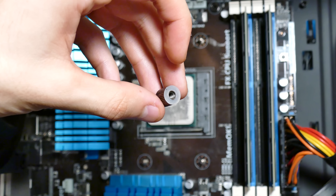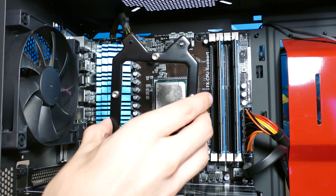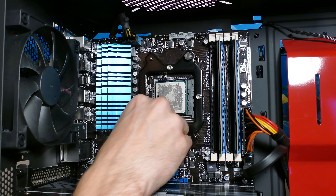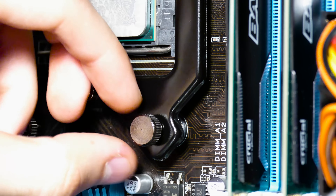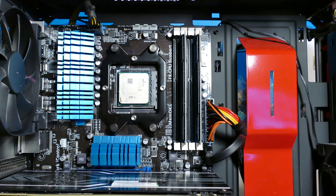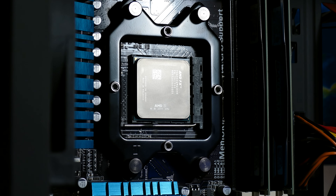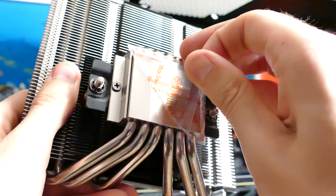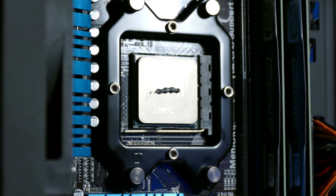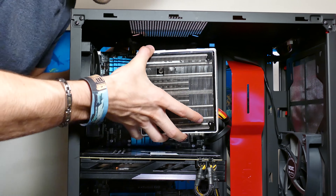Use the thumb screws lined with rubber pads on their bottoms to secure the new backplate, being careful not to over-tighten. Insert the front plate and use the short stubby screws to lock it into place, one on each corner. If your CPU has old thermal paste pre-applied, remove it with the included isopropyl alcohol pad — though note it's only 70%, and I recommend 90% or higher. After ensuring the CPU heat spreader is dry, remove the plastic cover from the nickel-plated base, apply a fresh line of thermal paste, and align the two spring-loaded screws on the cooler with the holes on the front plate.